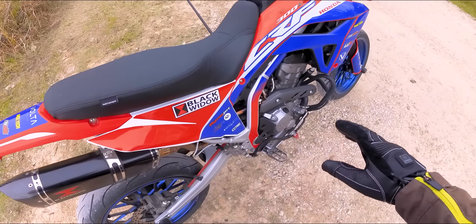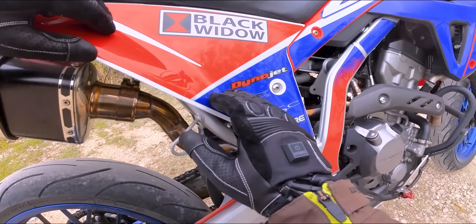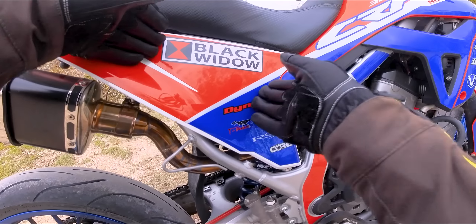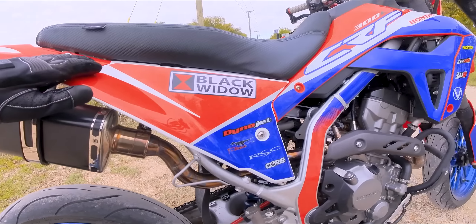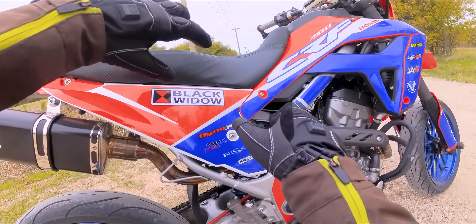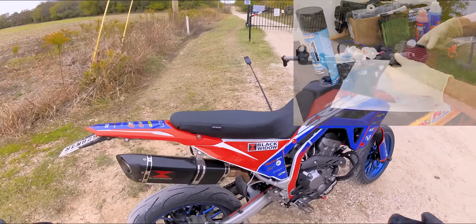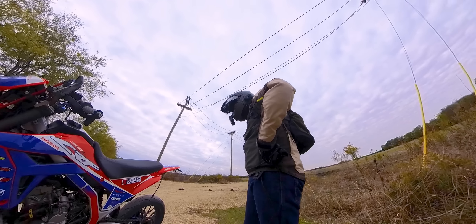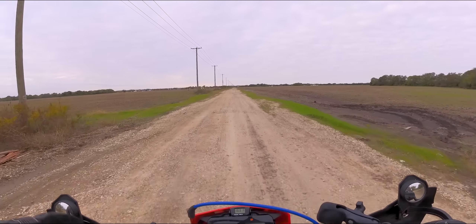So this is the panel in question, and here's how you could fix it. Make this plastic panel with maybe two or three little quarter-turn fasteners so you can pull it off quickly. Add a border that meets with a seal in the airbox — we don't even have to change the airbox itself. This is the only real part that has to change. We can still keep the airbox the way it is — just make the paper element filter a foam filter instead. We changed ours to a foam filter through modifications, but that's really obnoxious. It should just be that way from the factory. You look at it and go, that's easily fixable, and it would make it — let's be honest — like a real dirt bike.